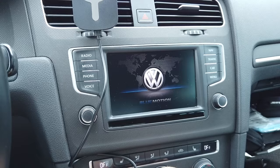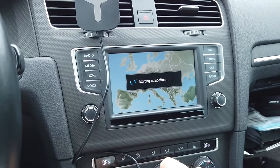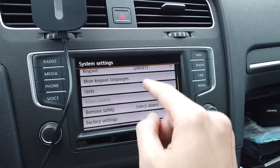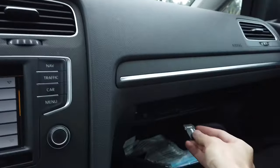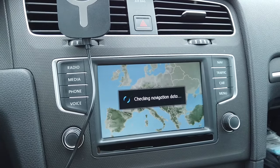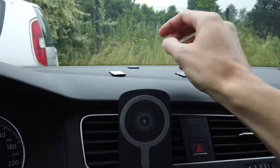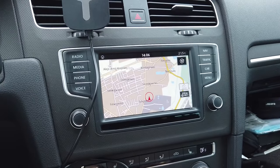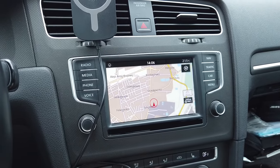That's it, and now we are waiting for the system to boot up again. Let's remove the toolbox card first, and now let's use the aftermarket card to check if that worked. Checking navigation data — and that's it. As you can see the original card is over here and not in the unit; I have a spare card that I just bought from an online store, copied all the files that are on the card which you can also download for free from the Volkswagen website, and I have this navigation working.